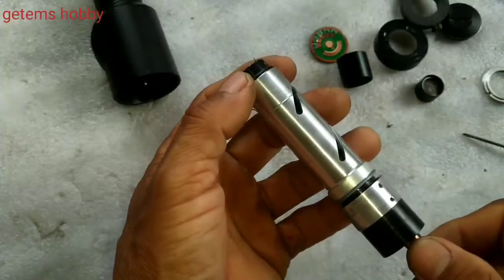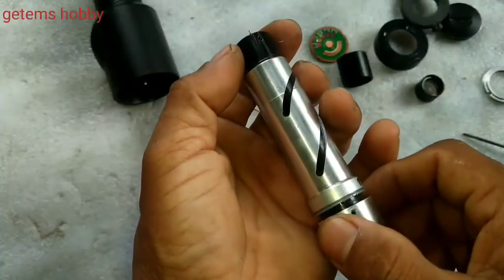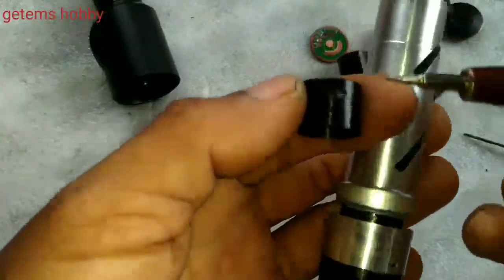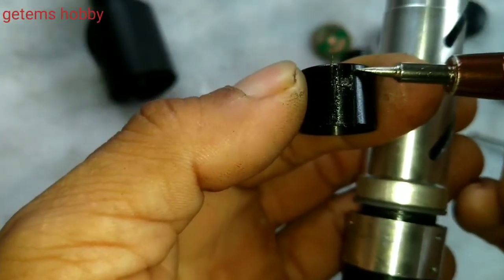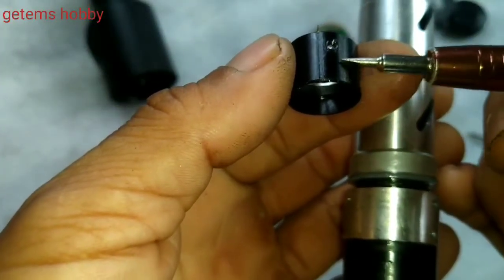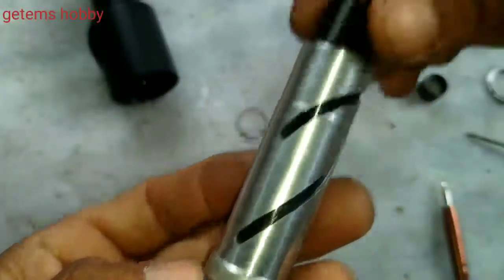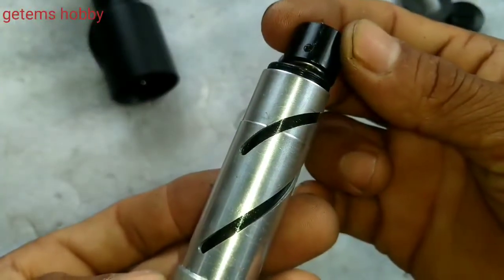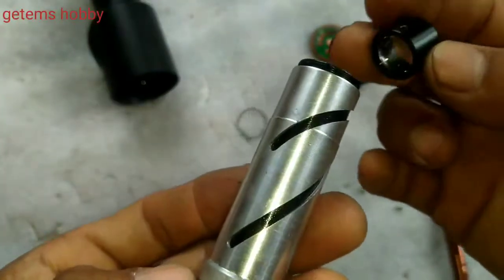See here — you should also observe the screw and how it is held inside. This lens is having a very little gap in the front and a bigger gap in the backward side, so this will go in this direction. Don't put it in the opposite direction, otherwise it will cause the same problem — blurriness.